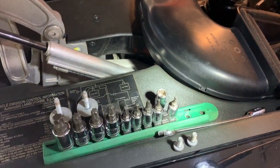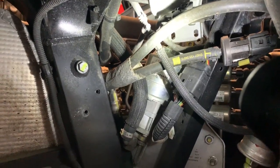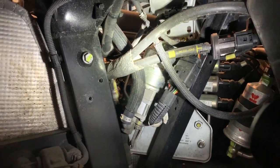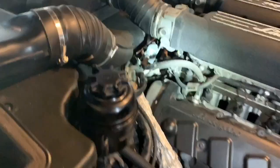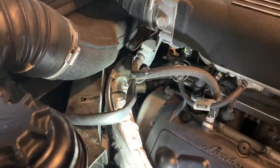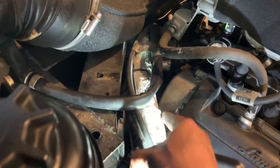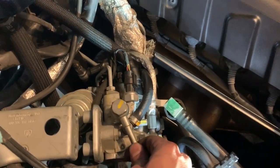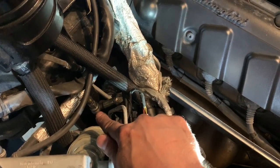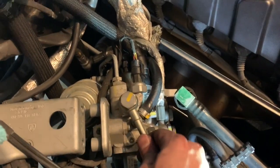You can see there are those two long ones right there and these two shorter ones. The two shorter ones come from the back. If you look up there you can see where the bracket has two holes in it — that goes into the back of the e-gear control unit mounting bracket. The other hole is kind of obscured by the e-gear pump. There's also a bracket here with an allen screw that goes all the way through the frame — pull that off and that frees up your e-gear lines. The movement is kind of prevented by this line, which I believe goes to the quick connect that leads to the transmission for the throwout bearing. So there's a little bit of wiggle room now.